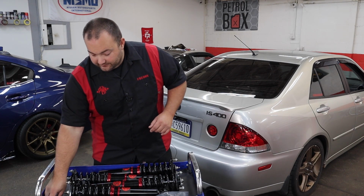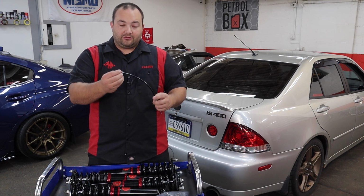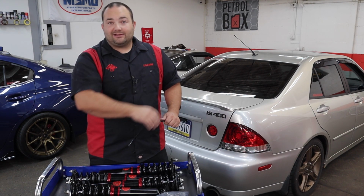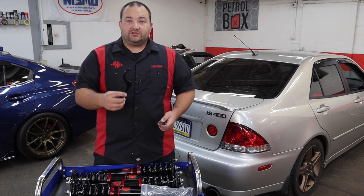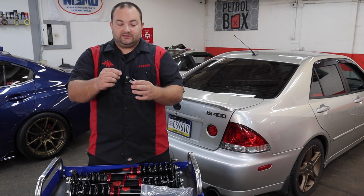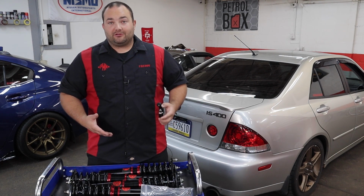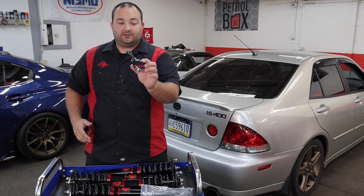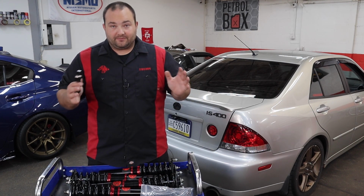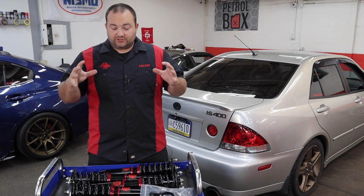One really nice thing that they come with for the rear coilovers are these remote adjusters. So you can put these on the rear coilovers and run this through your trunk, and you can adjust the damper setting without having to tear everything apart. So that's pretty cool. In addition to coming with 2 spanner wrenches, another cool thing that this kit comes with are these universal brackets for brake hoses and ABS lines. Some coilovers just kind of leave you hanging there. These offer you a solution to mount your ABS line and brake lines to, so they're a lot safer and won't hit your tire.